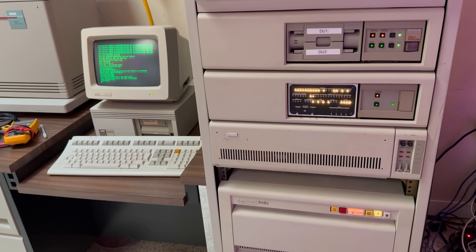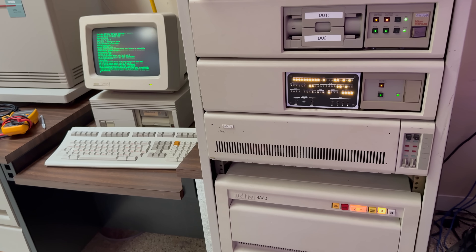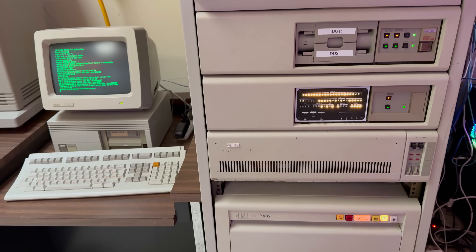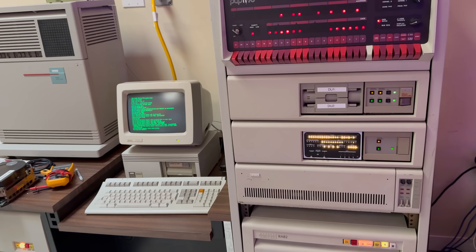The ready indicator comes on only after a fault-free spin-up. It even blinks if you've deselected both ports and the drive is running internal diagnostics - which I did by accident and then gladly took credit for discovering. The ready light will briefly wink off when serving an actual request, so it's the closest analog to a classic hard disk activity light that you'll find.